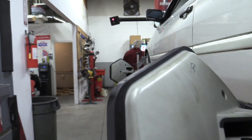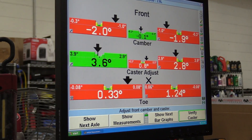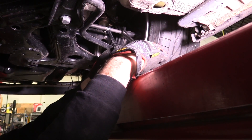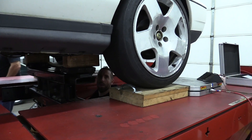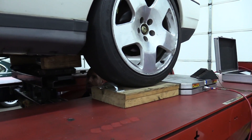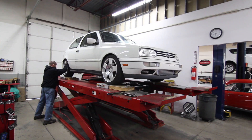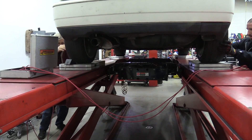With fuel, the reason you want half a tank is because that's about the average — when the tank is full there's more weight in the rear, and as that fuel is consumed it lightens up the back end. The suspension also needs to be properly aligned after installing the coilovers. We're working on a perfectly level surface, and we lift the vehicle and set it down on scales, rolling it on and off repeatedly to allow the suspension to fully settle and make sure nothing is bound up. Whenever you lift a vehicle, you need to jounce and roll the suspension before making any adjustments.